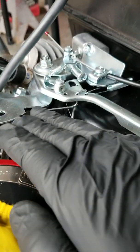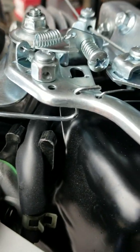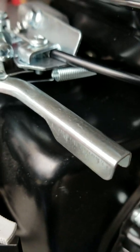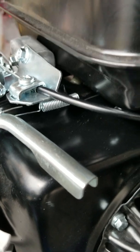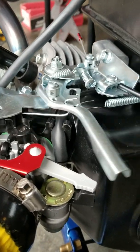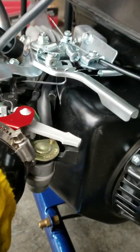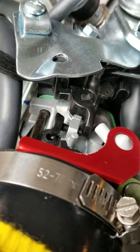What I've done is make a small linkage that runs directly to this arm, with a couple little bends in it, and modify the return spring. This runs up underneath the gas tank to the governor arm — it's super simple. You get full motion of your throttle plus a return.